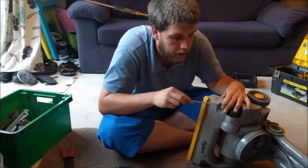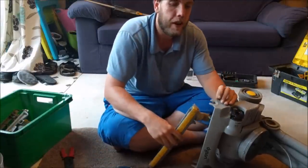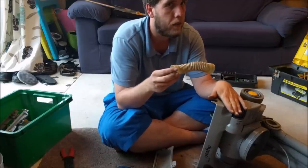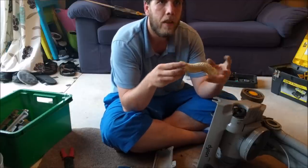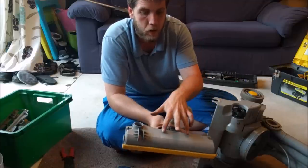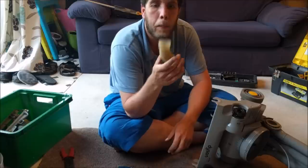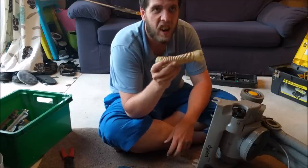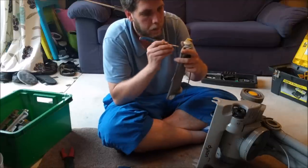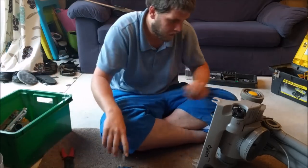If the machine's still upright, take your screwdriver and ever so gently insert it as far to the edge as you dare and very gently lever it — I'll reiterate: very gently, because otherwise it will snap. There's your internal hose. If your machine doesn't work very well, this is worn on all white Dysons. This one is a bit bent — it should be straight and really springy. This is quite floppy; that's what pushes the head onto the floor. Once through the washing machine the plastic sorts itself out and makes it a lot better, but I forgot so we'll pop that over there. There are rubber seals at the front and back that I'll remove for the purposes of this video.